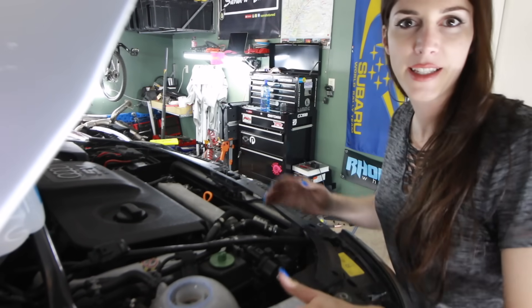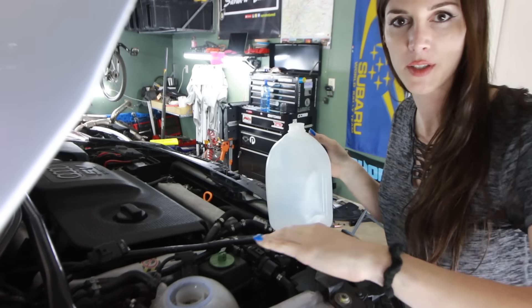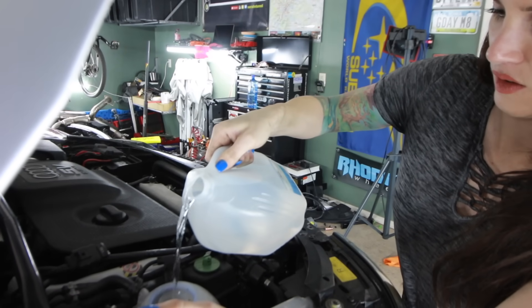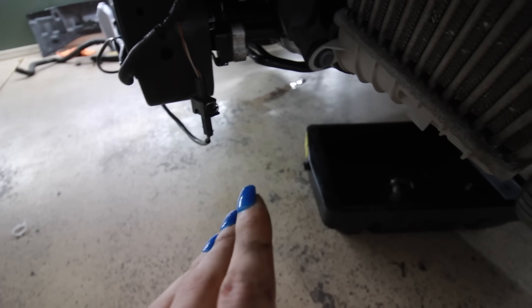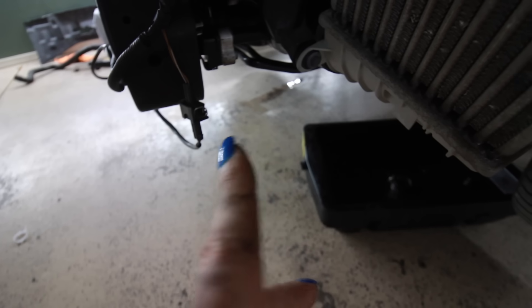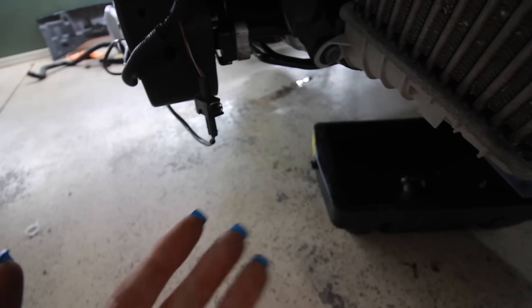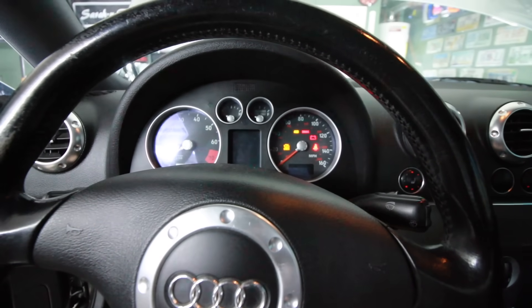Here goes nothing. Everything is connected. I'm going to use a little bit of distilled water just as a leak test without pressure — I'm going to pour some in there. Looks good so far. This is just a very basic test, I don't have any pressure on the system, but I just want to test with water real quick to see if I had any massive leaks. It doesn't look like I do, so I think I can go ahead and put some coolant in here and add pressure. Great, battery's dead. So that's awesome. I guess I'm not going to be doing electrical troubleshooting in this video. It's already 7 o'clock at night.